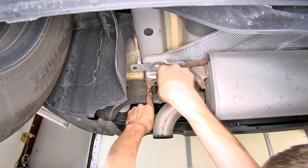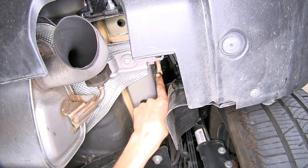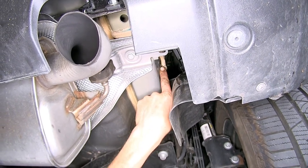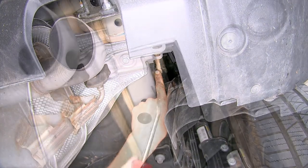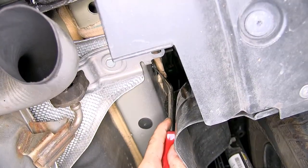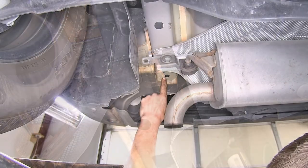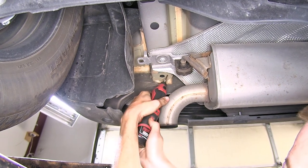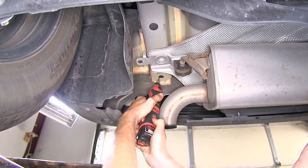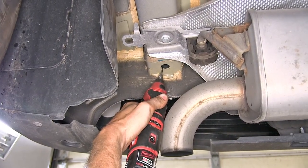We'll pop this one out. Now on the side of our frame rail, we have another plug — there's actually two here. This is the forward most one; this is the one you need to remove, so make sure you take out the right one. We'll pop that one out as well. Now we need to enlarge our bottom hole in the frame rail so our hardware will fit through. I'll use a rotary tool with a cutting bit on this. You can also use a die grinder, step bit, or a hole saw if you have one.